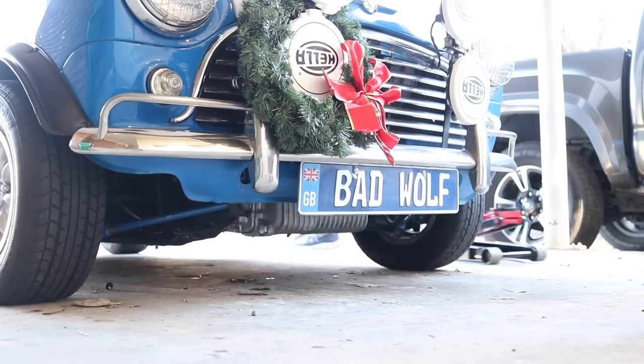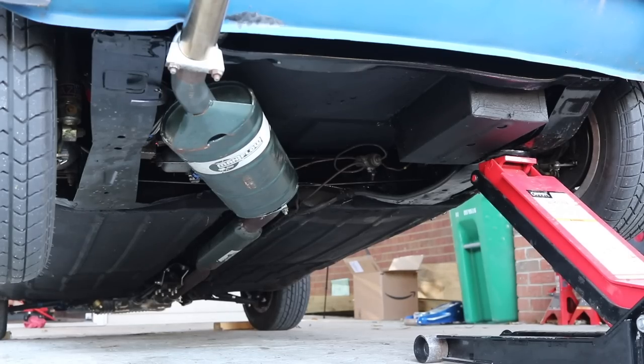Just like with the front of the car, you are jacking from a subframe instead of the body of the car. You can see I've got my jack still in place, and if you look up toward the front of the car, you can see the wheels are chocked with a piece of wood — that is extremely important, especially when jacking the rear of the car. The front you can use the parking brake, but you should still chock the wheels to make sure the car doesn't roll. On the back subframe, my two favorite jack points are right at the very front corners of the subframe and along the back flat portions that extend toward the rear of the car. You absolutely do not want to jack from the middle of the rear subframe — that spot right there will almost definitely bend and cause problems if you ever have to remove the subframe in the future. Avoid jacking from there and you should be in good shape.